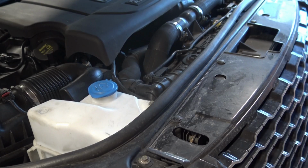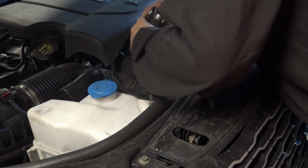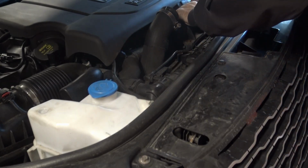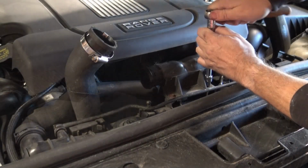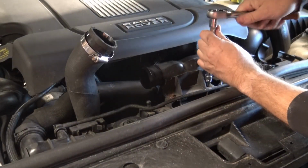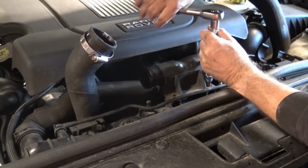There are 2 air inlet hoses coming from the filters on the left and the right hand side. Remove the hose clips and pull them away from the hose union. I took the right hand one, which is quite long, and held it back with a piece of garden twine out of the way. Then remove the 2 13mm bolts which hold the hose union in place.